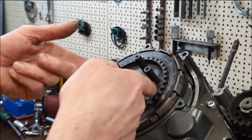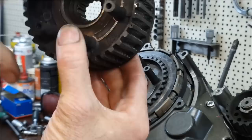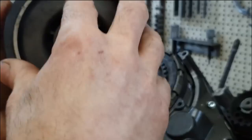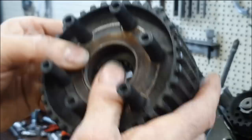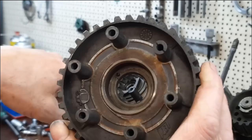This also means that the clutch assembly, because basically this is the outer part, the drum, and in the back there's a steel part which functions as a transmission absorber. What happens is if this wears out, the aluminium part can come to the front and then the clutch starts moving like this, wobbly. That's also the reason why the bearing housing inside the casings gets damaged.